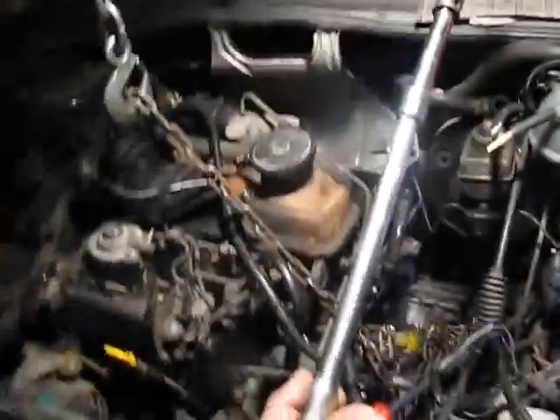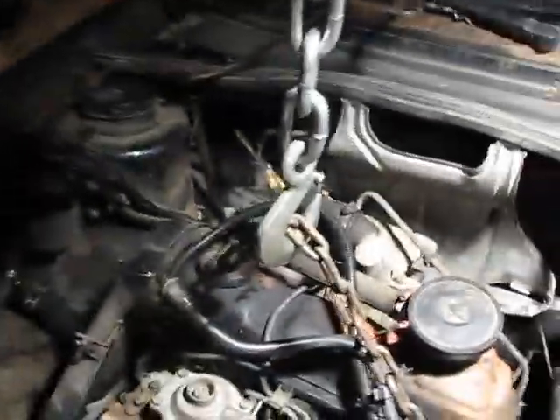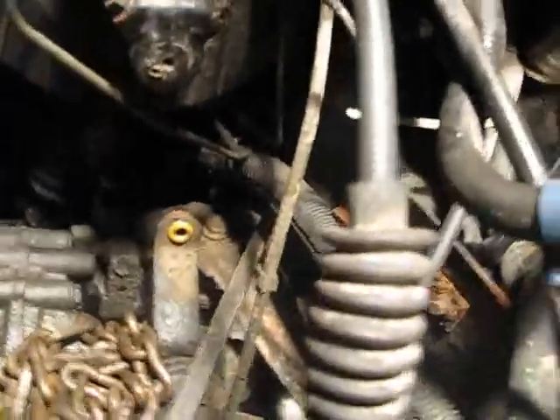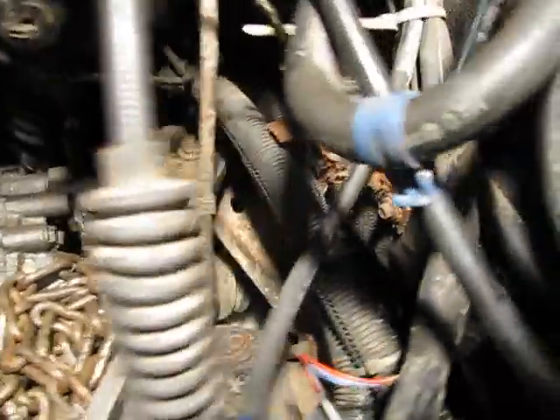That's friggin' things, like, three feet long. Probably gonna friggin' cut my arm off doing this. I got the two exhaust clamp things off and there was a motor mount that was right behind there. It was pretty easy to get to once you took all the turbo piping off, but I couldn't see it. I saw it when I moved the light. So I got that to come off and then I think it might be good.